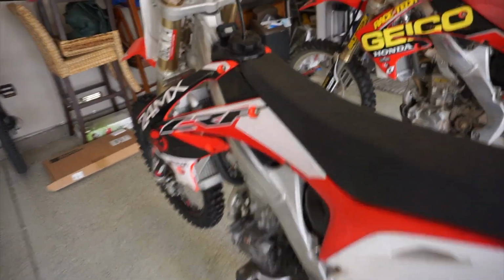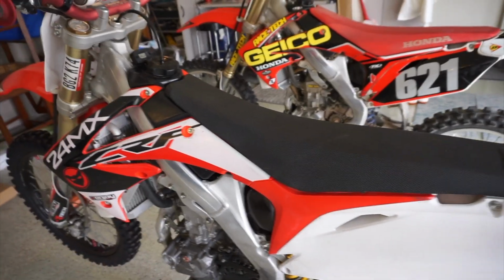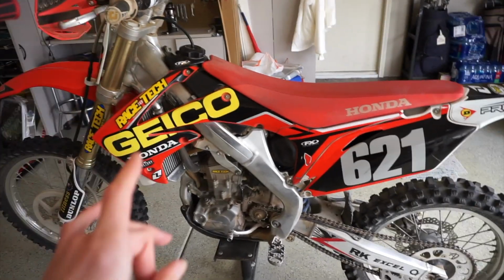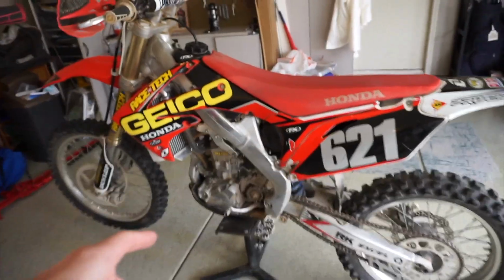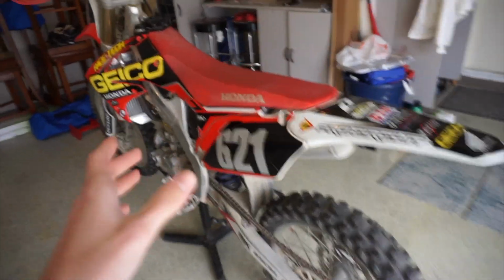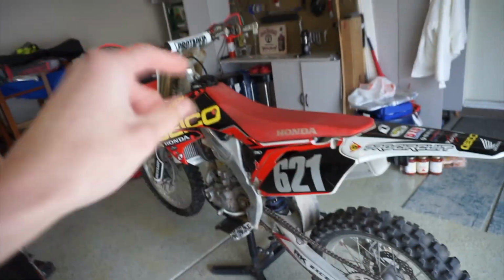So as you guys saw in the last video, I've been trying to diagnose some problems with my bike, it cutting out during idling and not starting once it's been run all day. But Garrett came to me saying he has a problem with his acceleration. When he's under acceleration after warming up, his engine tends to bog out and cut out completely. So in doing my research, I'm finding that the most practical reason that's happening is the fuel pump. Now it's either the fuel pump or the fuel filter attached to the fuel pump. So I'm going to be replacing the fuel filter on his bike's pump and see if that fixes his problem.